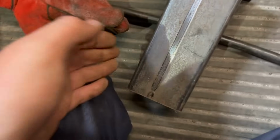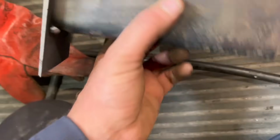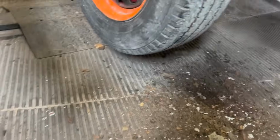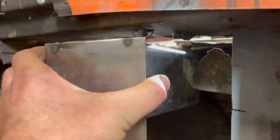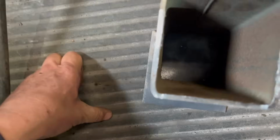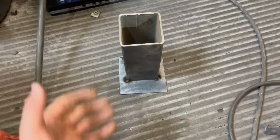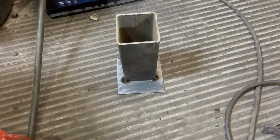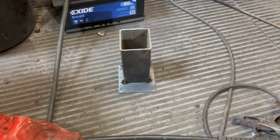Right, so one of the outriggers is actually a little bit rusty, and we've got some box here, and it is exactly the same size as the outrigger, so we're just making our own outrigger to go, literally, in there like that. Perfect. I'm glad we've had that, because that saves a lot of messing around. Bit OTT, but it's a good jacking point reference there if you ever need to jack up in a weird position. So I'll buzz this up now and we'll get it fitted.